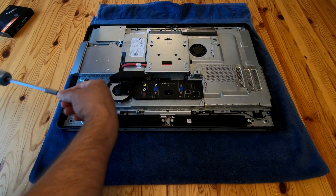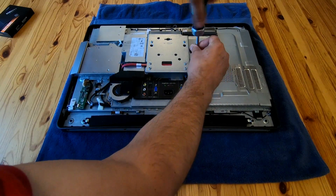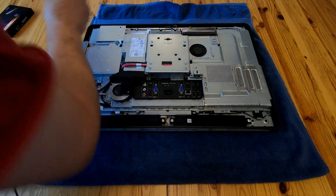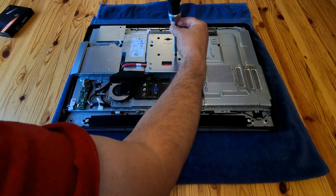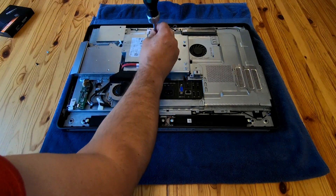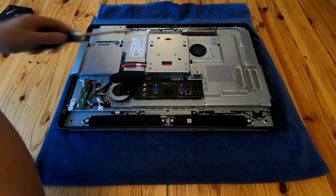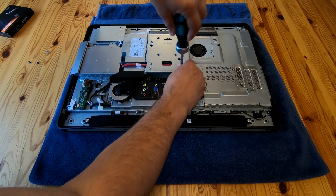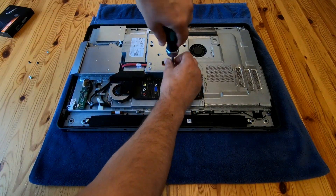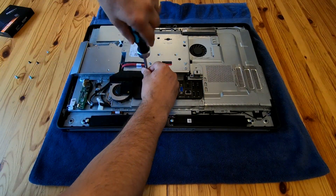There are only those four screws at the bottom — there aren't any others. Inside there are other screws of different sizes, so get them in the right place. There's a plate here so I'm going to take that off. That's one side and that is an M3 screw, though I think that refers to the service manual designation rather than the screw size. The service manual says unscrew all these screws — there are two there, one there, and another two down here.